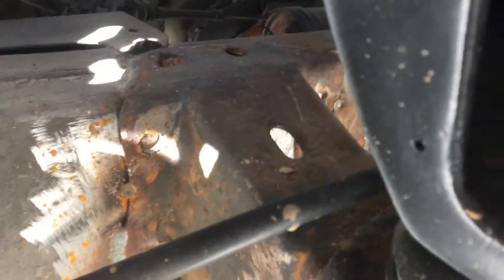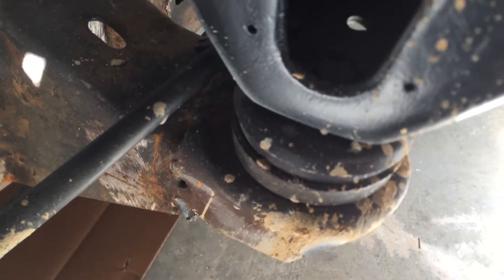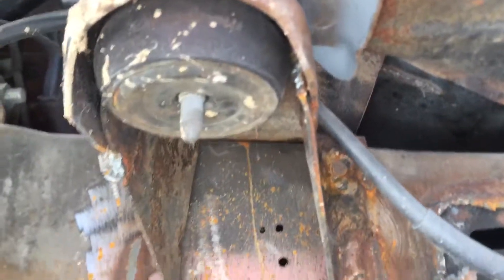On the front, I've got it tacked into place and welded around the bottom. It's the original F-100 cab mount from the frame of the F-100, and then I cut the original mount off the Mountaineer and extended it on top of the original F-100 mount so that it mounts original.